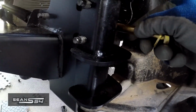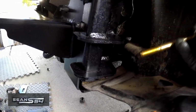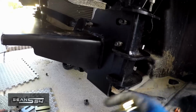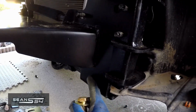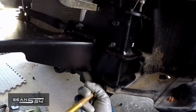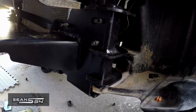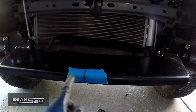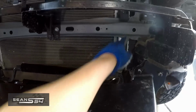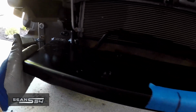The bolts on the bracket on the side, there's 2 on the side, they work perfectly, but there's one going this way and it does not work without drilling into the Bulldog winch plate. And I think when I checked it, it actually comes through right around here. So either I'm going to cut this plate and just install the 2 brackets or not use it at all. We'll see. I measured the center of the mounting plate and the center between here and here, so it's right about there. So luckily I just have to slide this all the way to the right.